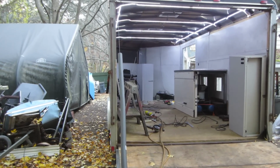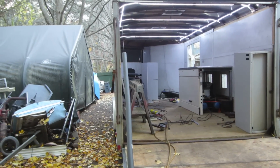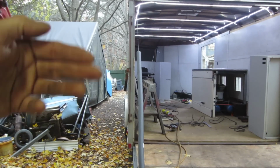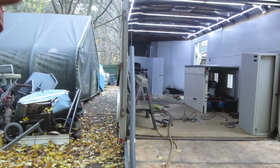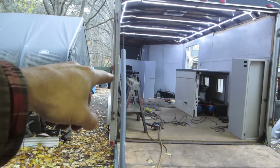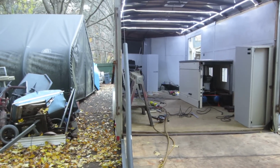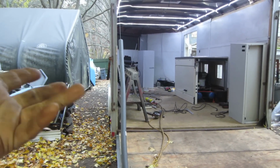The thing probably weighs about 1,000 pounds. Yeah, we can knock a little bit off because I'm going to shrink it down a little bit. Say 900 pounds. I'm going to take some of the framing away. And then the closer to the front of the tongue, the more that weight becomes important. So if it was right across the front of the trailer, and say it's 3 feet from the tongue, its effect on the tongue weight would be 600 pounds, say 2/3 of it.